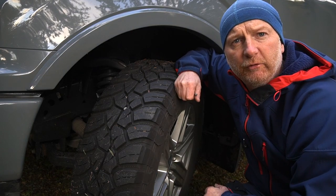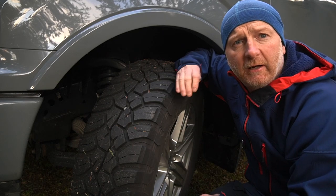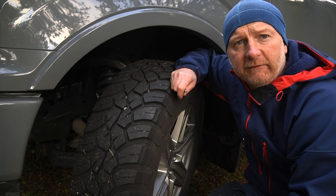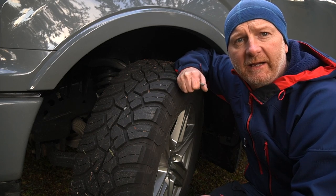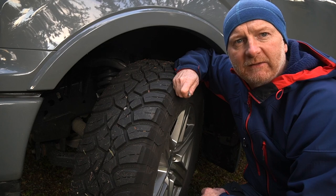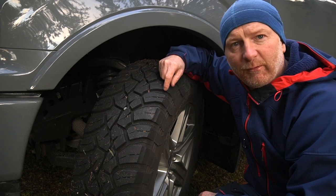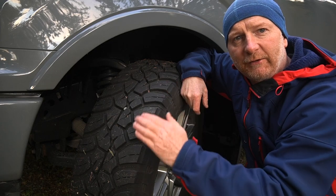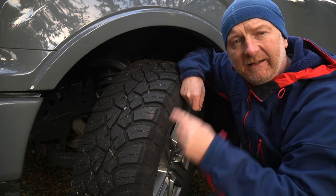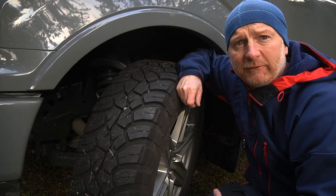Noise — they do make noise. Yes, they have a rumble. I find it a good rumble; I never had a problem with it. It only got annoying at the beginning because I've never driven a mud-terrain tire in my life. When I first had them mounted and balanced, I had them rebalanced with a road-force balancer because I thought they'd been balanced incorrectly. I found out they were balanced completely fine. Each block hits the road with a gap, so you get gap-block-gap, and it resonates through the steering wheel into the cab — I just wasn't used to it.